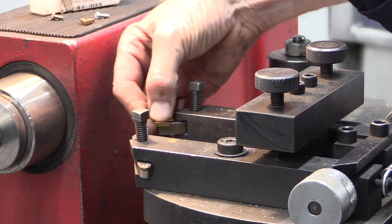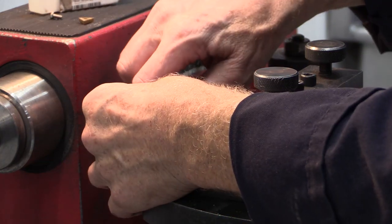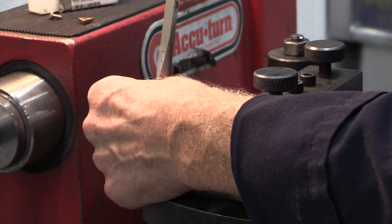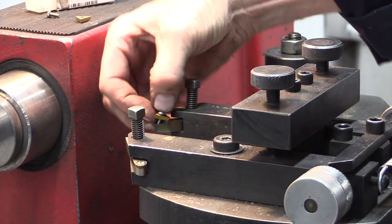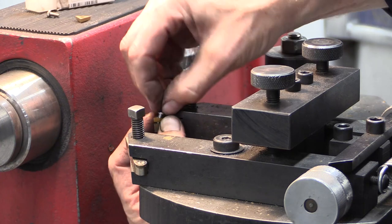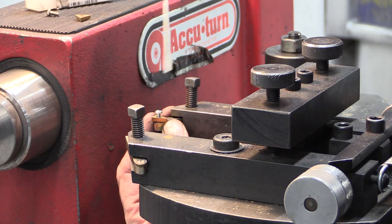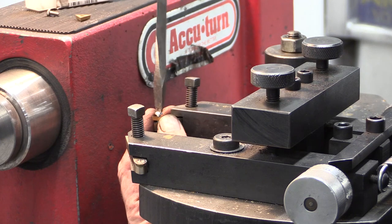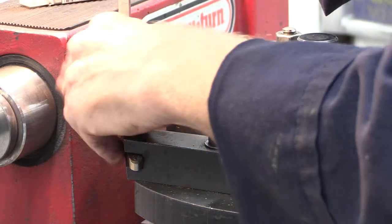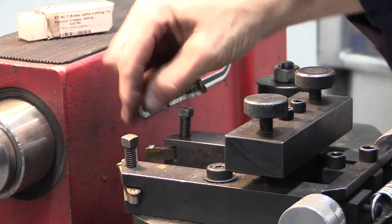Make sure things are cleaned off so you have a good surface. Please use a good-sized screwdriver when putting them in. We want these bits held in place firmly. A little skinny screwdriver blade is not going to be sufficient — we want to have good torque on this and have it sitting in place. When one point gets worn, you can rotate the bit and use another corner.